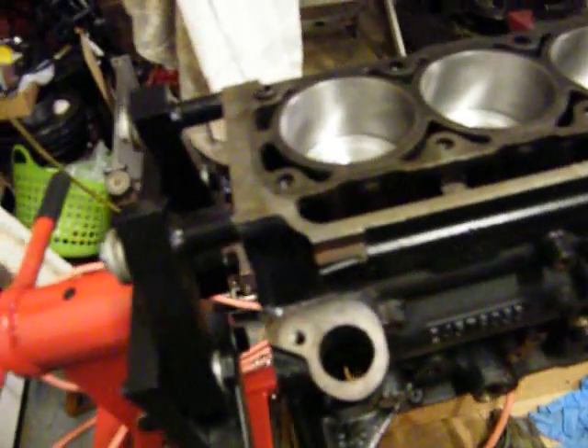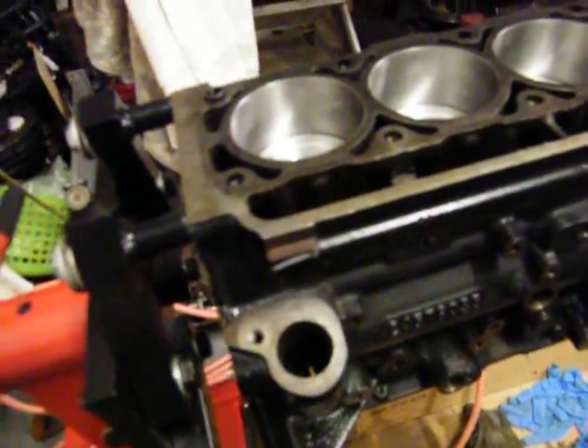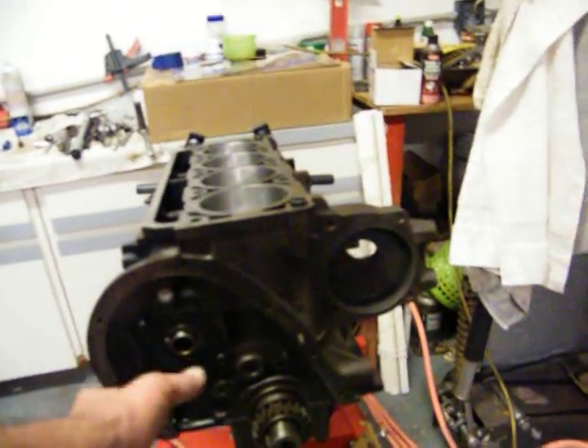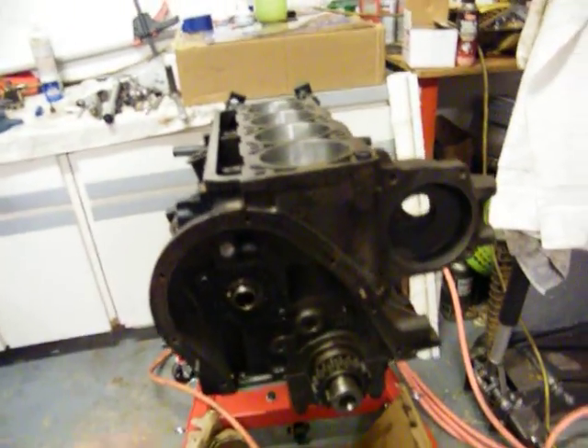Now what you do is put your oil pump gear in — this used to be the old distributor, but they don't call them distributors anymore. The gear goes down there so the pump will work. Then get that in and put the timing chain on, which I'll have to use the cam gear up here. I'll put that in using the old one to check that out.